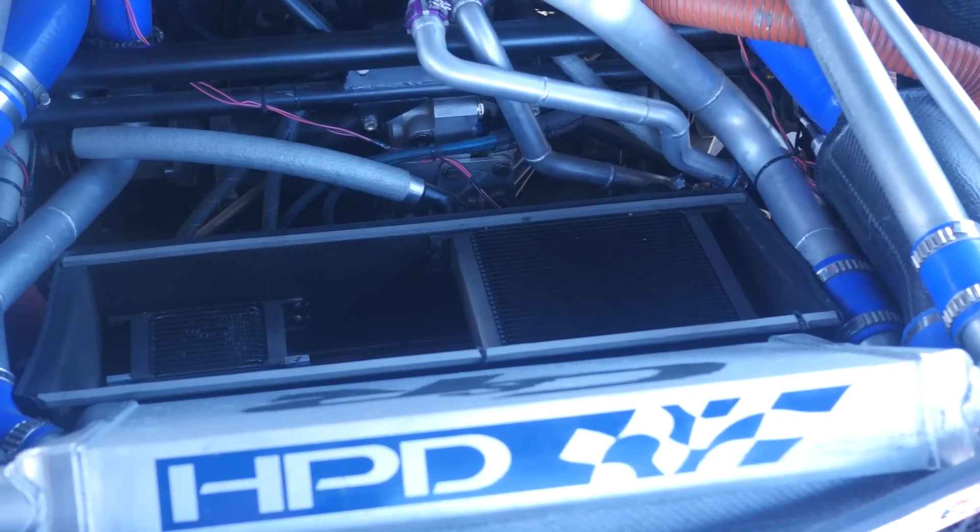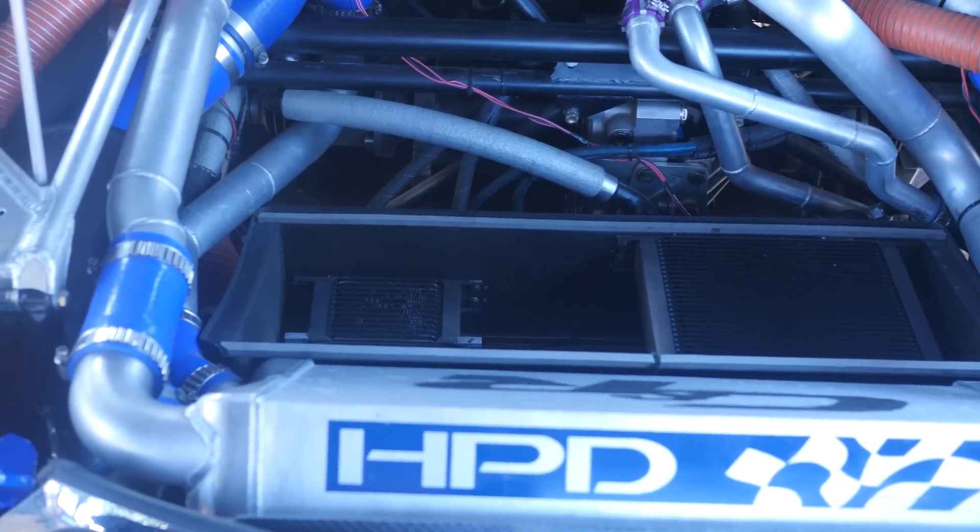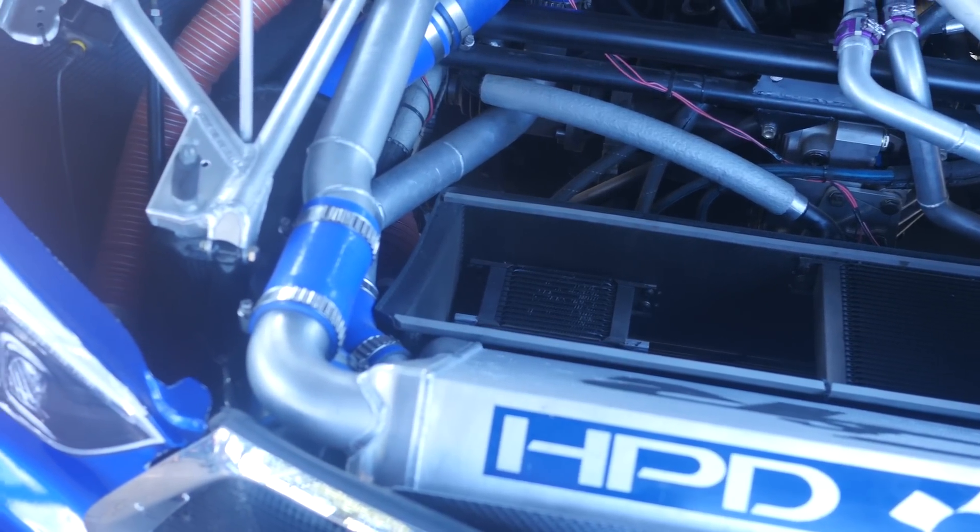Getting the engine coolant under control is only part of the puzzle — we've also got oil in the engine, there for lubrication but also taking a lot of heat away from the combustion process. For a factory engine with no oil cooling, a simple remote mount oil cooler kit running off an oil filter adapter will really help both with engine oil cooling and engine coolant cooling, since the oil has more direct contact with the engine. Sometimes putting an oil cooler on can actually drastically help your water temps as well. For more serious applications, a full face oil cooler behind the radiator is an option — and moving to a slightly thinner radiator can open up the rear of that package for additional oil or transmission cooling.